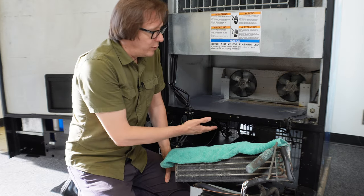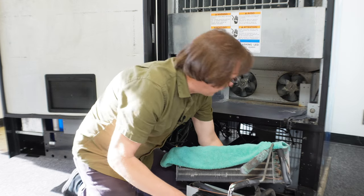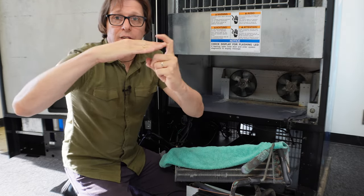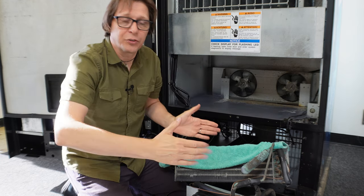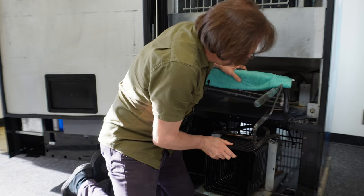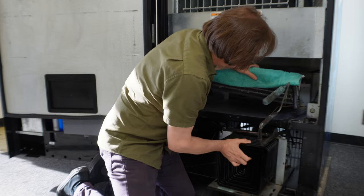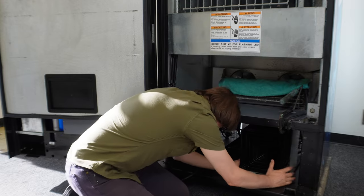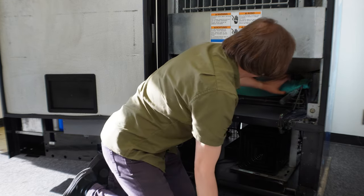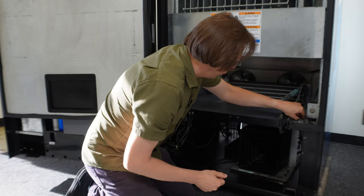To put everything back in, we just reverse the process. Leave the towel on the evaporator coil and go ahead and slide the assembly into the back. In the bottom of these Dixie Narco compressors, there's a little hook — a little tab — where this refrigeration deck will connect into. There's a little hook in the back of the cabinet; slide the compressor deck to line up that way, and it will help you line the screw holes up. Lift up the compressor, grab the evaporator coil, slide it up, and make sure the power cord isn't being caught anywhere. Slide it in and look in the back to line up the holes for the bolts.